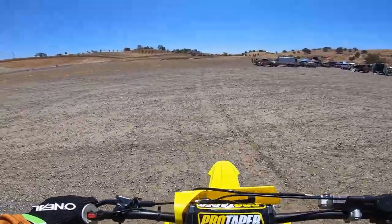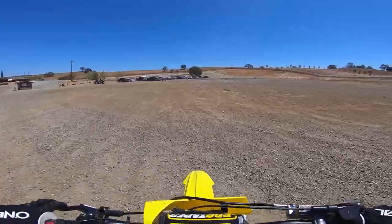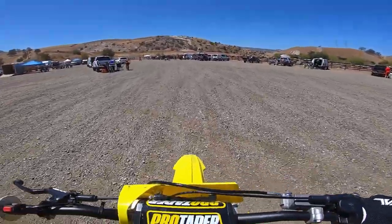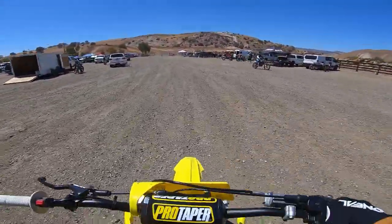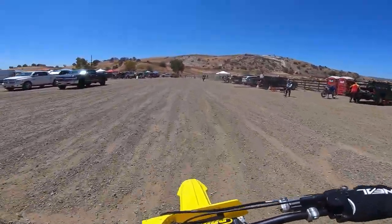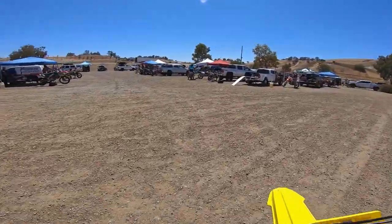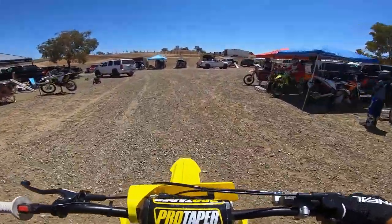Okay, lift the rear tire right up. Probably about, I don't know, 20% throttle. Nice. Feels good. Compared to the Lectrons you guys are running right now, the 38 HVs and the H series, which is the newer 38, I can tell that this Billetron has more pickup, more grunt off the bottom. That's one complaint about the old Lectron, is that even though it smooths the bike out and deletes your need for jetting and just generally runs a lot smoother, a lot of guys complain that they have a softer bottom end.